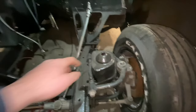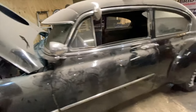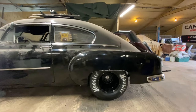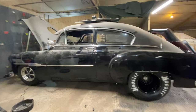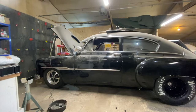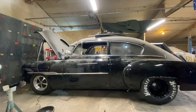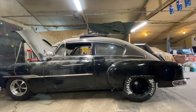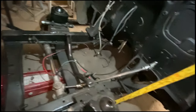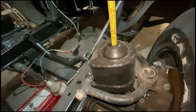We're going to take a measurement from here down to that bottom pin on the bottom of the control arm. You can see I've just got a jack underneath the front of the car sitting at ride height. Looks tough as nails. There's a slight rake to the front - I think the front is probably two inches lower than the rear. I'm kind of hoping that's okay for weight transfer, but the shocks are adjustable anyway, the coils are adjustable. The old tape measure fits straight down there, sitting on the bottom right there - that comes up at about 14 and a half inches. Let's make some shocks up.